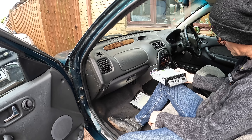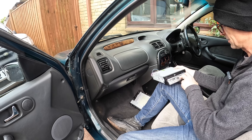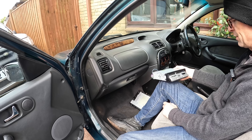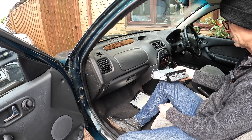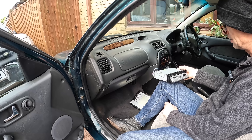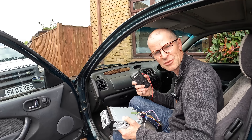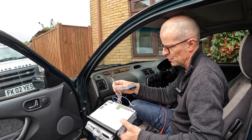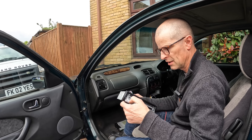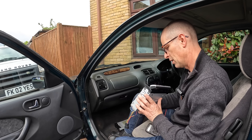Like on the 400, this radio was working - it powered up fine, I had radio stations, could play the CD, there's actually a quite decent disc in there I didn't realise I'd left in it - but now it's absolutely dead. I don't know what the problem is. I was going to ask whether I need a specific R8/R3 loom but clearly not because it was working. I've tested with a meter: I've got 12 volts on the permanent and the switched feed all the way to the radio and everything appears correct going into the right ports, but the radio was working and now it's not. I'll have to go and get one of the many others from the barn.